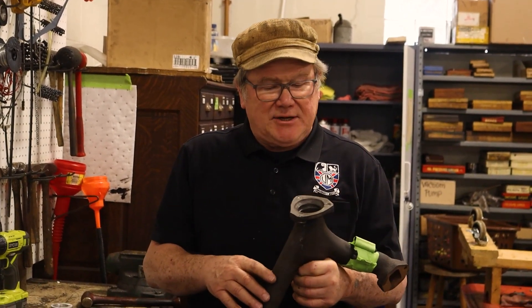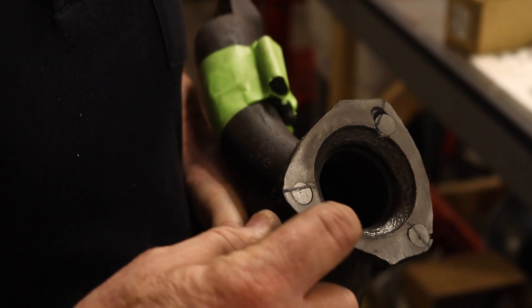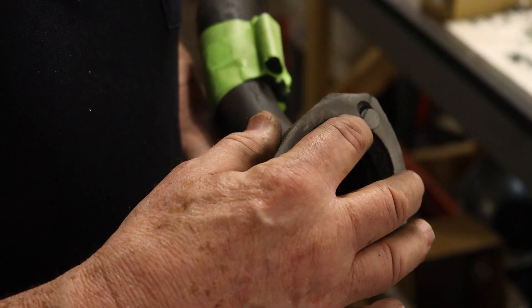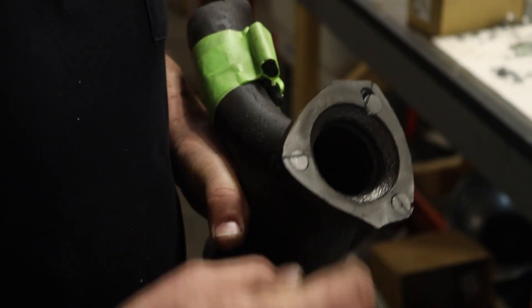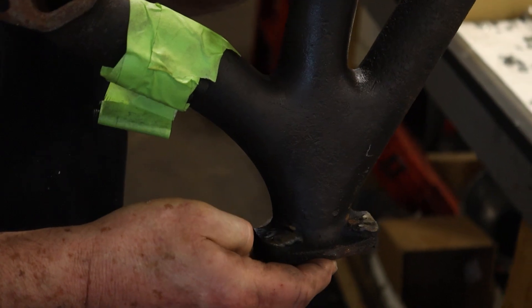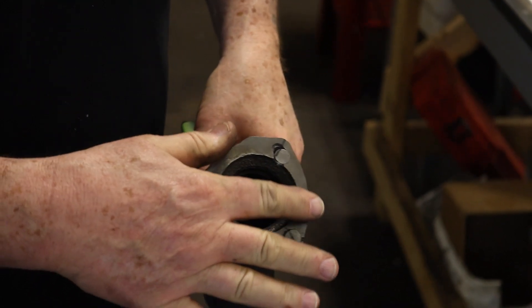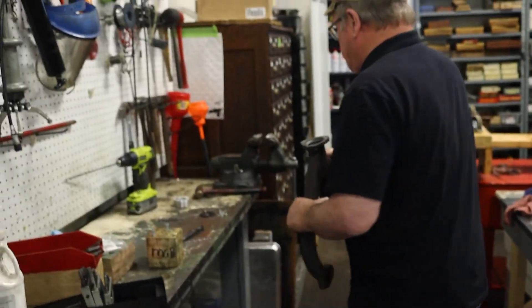But if you want to correctly get the manifold set back up, this is how I do it. We're going to come in close with the camera, and you can see that I've drilled out these holes and put in half-inch coarse number two grade two bolts — real soft bolts. So I've tapped these and screwed in new bolts. Then on the back side, I've welded across there so the bolts can't move, then ground it off so it doesn't look too horrible. With some paint on it, it'll look better. Now I've got a relatively flat surface — I've put this on a surfacing plate sander and sanded it all out.